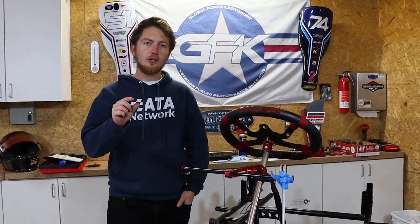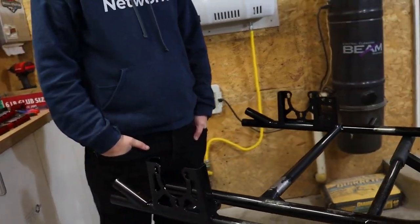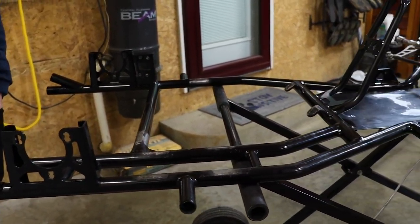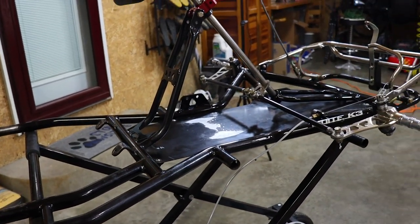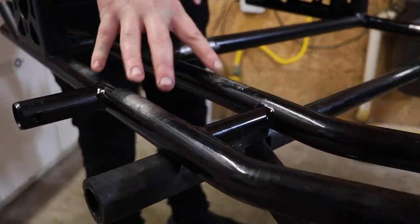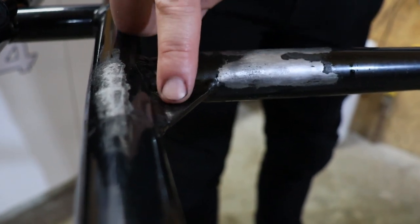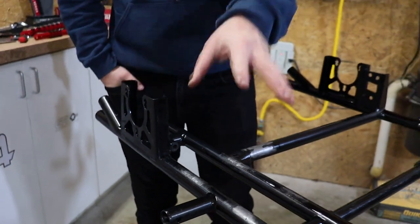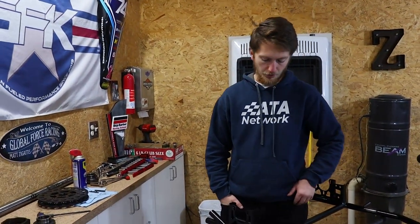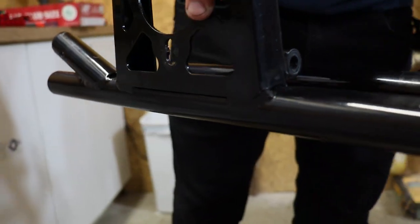Now our cleaning process is done and we begin the inspection process. A little spoiler: we've already done this, but I'm going to walk you guys through things to look for and tell you what we've found with this chassis. Starting in the rear — these carts have had some issues with cracks in the chassis. It's not a super common issue, but we do see it, and when it happens there are a couple of different spots to look for. With the motor mounted here, it's a common spot. Usually you'll see it at this intersection in the chassis — that's why they added that support structure there, because with the motor here, this is where a lot of pressure is put on the cart. You'll also see it in the cassettes, which we've already discussed — we do have the crack here in the chassis.